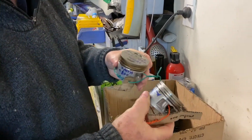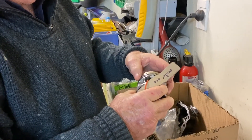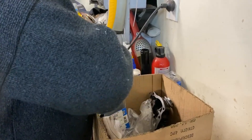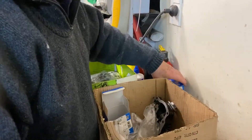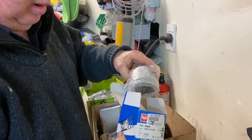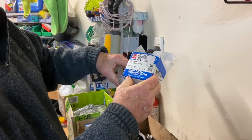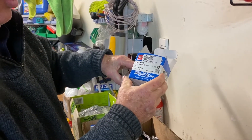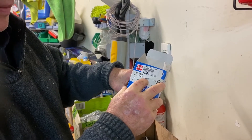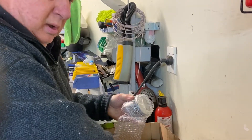The pistons — there are two, one for each bike — were both undersized for the cylinders, and the rings were rather sharp and worn out as well, so we replaced them with new pistons. These are not genuine but made in Japan — this company makes a lot of stuff: trkj.co.jp. These are pistons for an XR 200 or XL 200.